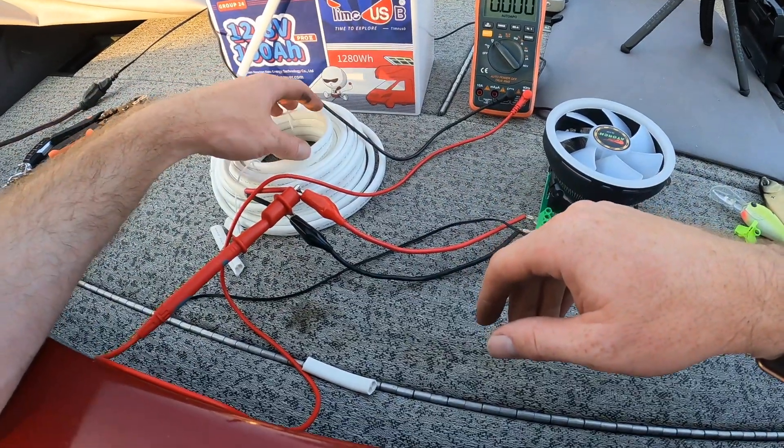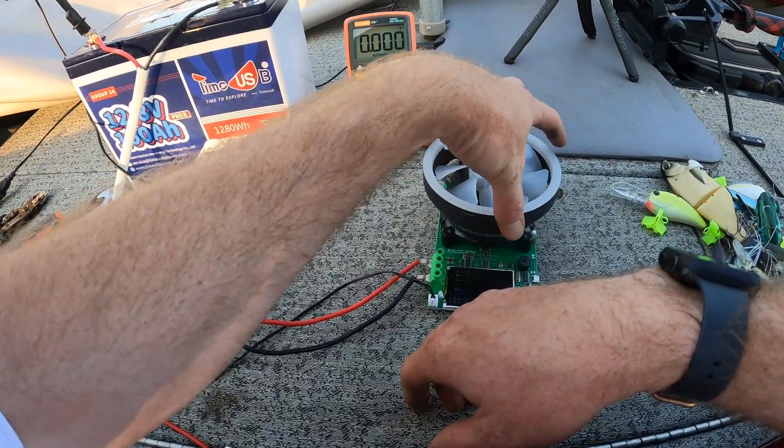What we have here is a coil of 25 feet of 10 gauge wire. That's a long run of wire, but it's not too crazy depending on how your boat's set up — it may be a little aggressive. And what we're seeing is 0.0 volts. There's no load going through this wire, therefore there's no voltage drop.